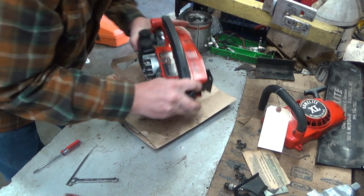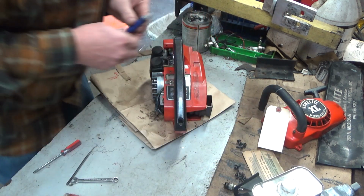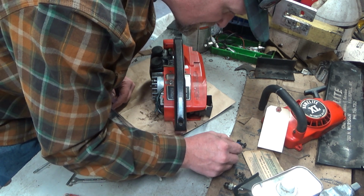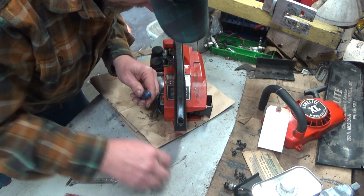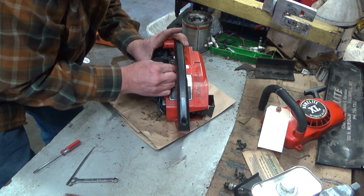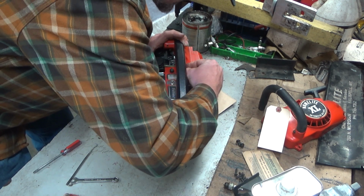When I think about all of the throttle handles I risked breaking, and in a couple cases did break before I learned that trick, my goodness, it is no good. I'm going to do a little Loctite blue on these engine housing screws, because I have seen too many of them rattle about and then rattle out. And why, if you don't have to? Especially with the plastic housings, it's good practice with any of them.